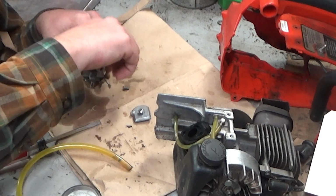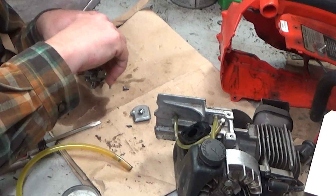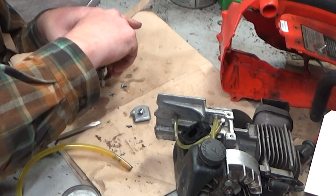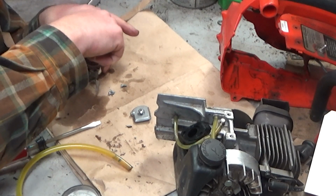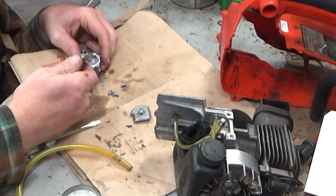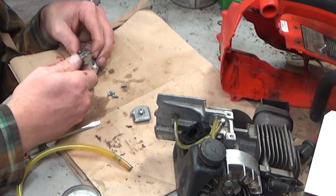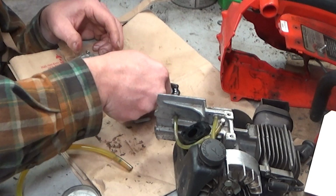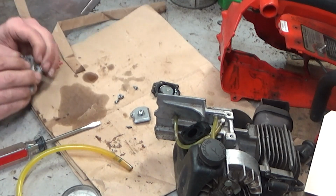Generally, unless there's something goofy going on, when you clean a carb, you don't need to take the needles out. Unless there's dried fuel. And then it's worth cleaning them, but if there's any risk of mixing them up, it's almost better to do them one at a time. But I'm not at all convinced that's what's going on here. Okay, so that all looks good. Proper plastic disc is still here. Don't ever lose that. Those are not available anymore.